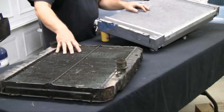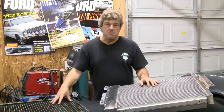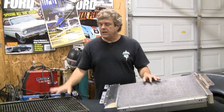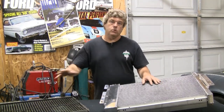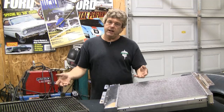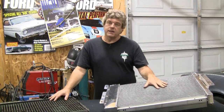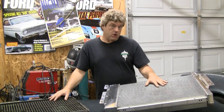This is a 1968 original Ford Motor Company big block radiator - what it would have been back in 1968 - and it has the cross flow on it like Ford set it up for big block applications. On a '68, with a little bit of modification, you can put one of these style radiators in a classic Mustang and it will do everything you need it to do. Everything I've read says that top and bottom tank radiators really aren't any less efficient than crossflows. This one's just nice and pretty aluminum, going in the Camaro we're working on.